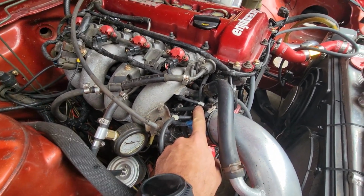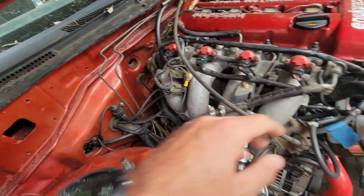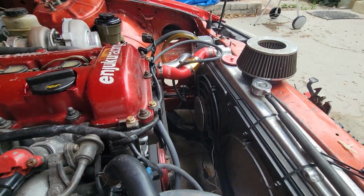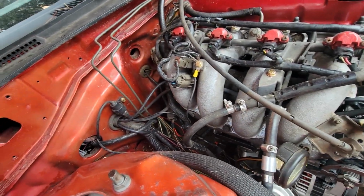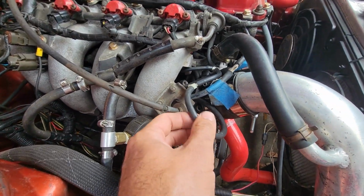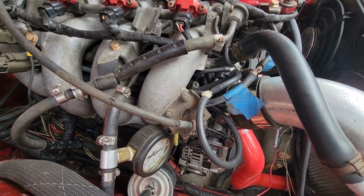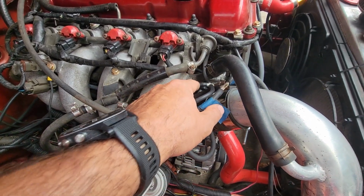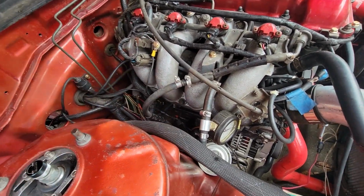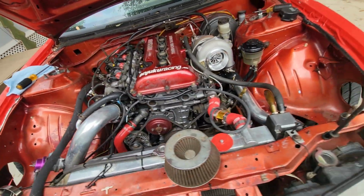So, I teed this connection in. It's supposed to tee into the fuel pressure regulator, but what I'm not sure of is this is running to the boost solenoid. Not the solenoid. The boost solenoid's down there. That comes from, you know, tees into the wastegate line. This, I don't know, reads your boost pressure, I guess. Whatever. Sends it to the computer. So that's what this line does. And everything's real long right now, just to make sure there are no leaks and craziness. So I'm hoping that this extra T doesn't create problems. I don't think so. This is more about a pressure sensor that happens almost instantaneously, like the speed of sound to the computer. So we're going to hope that's correct.